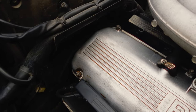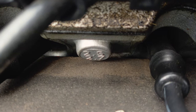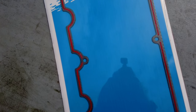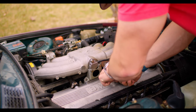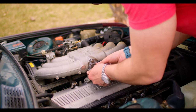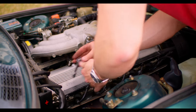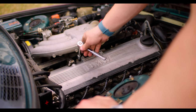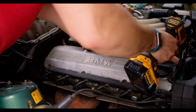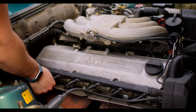Now that we've spent some time on the intake side of the engine, I think it's time we give the exhaust side some attention. The valve cover itself doesn't look too terrible; however, the gasket is actually leaking. Whoever did it last used way too much RTV, and there are chunks of it everywhere, so now is the perfect time to replace it. On this car, unlike my Audis, it's a seriously quick job. You've got to remove a bracket connecting the valve cover to the intake manifold and one single hose clamp, and then you're already at the stage where you can remove the bolts holding the valve cover on. This is going to be a really fun opportunity to look at the head of this engine — the car is over 30 years old, so I'm really curious what it's going to look like in there. You can tell quite a bit about how a car was cared for by looking underneath the valve cover.